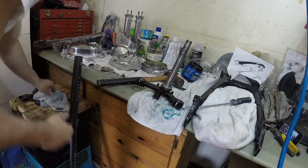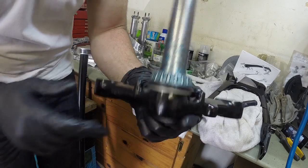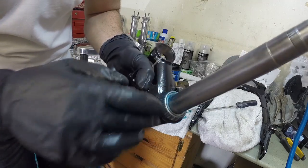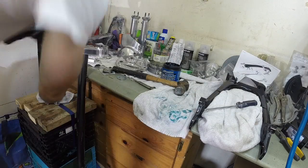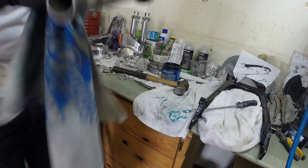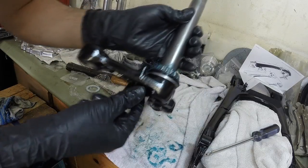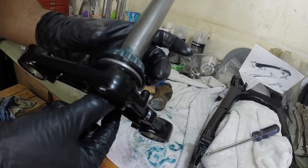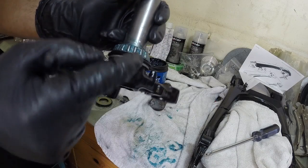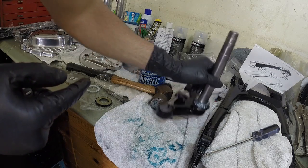I'm gonna get the old gloves back on and then let's give it some more grease there. Alright, so I just added a little more grease onto the bearing, and now it should be ready to fit up inside the steering column. So I have my lower bearing installed. That's all good. I got my thin washer, the dust seal, and the bearing all greased up, ready to go.